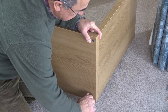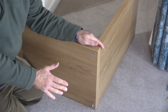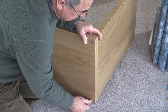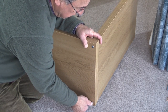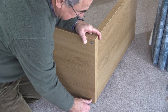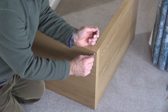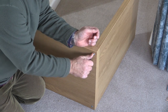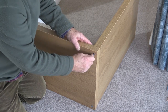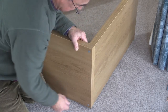You'll find that towards the end it's starting to get a little bit stiffer. This is where you have to use judgment as to how tight you can make these go. You'll start to feel it getting tighter and tighter — it's harder and harder to turn. But when it seems to be getting no more difficult to turn, it's probably tight enough. The size of this tool is such that it is actually quite difficult to over-tighten something like this with so little leverage. So I'm tightening that up until I'm pretty satisfied that it is nice and tight, and the same with the bottom one.